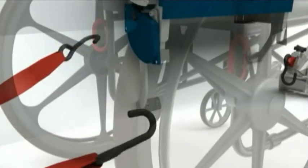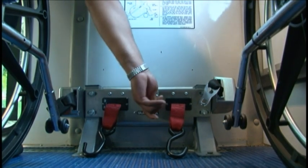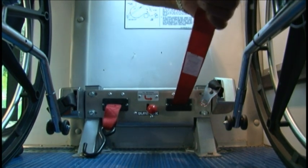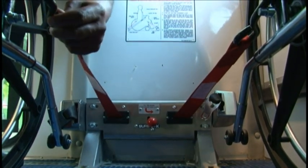First, you'll need to attach the rear belts. Some mobility aids will have areas clearly marked where belts should go. To do so, push the lever on the Dual Auto Lock down and to the right. The built-in time delay offers free movement of belts for approximately 20 seconds, and both hands are now free to secure the mobility aid.